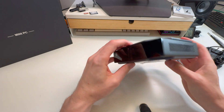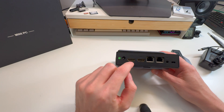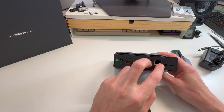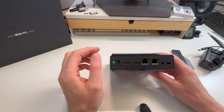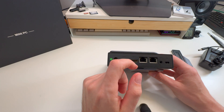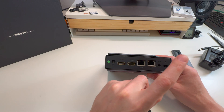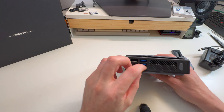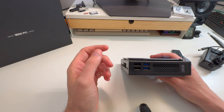There's the LCD on the side. On the back we have a decent IO: DC power in, dual HDMI so you can run two screens, dual Ethernet — which already points towards potential use as something like an ad server or network device. There's auxiliary in for speakers, a lock port, and four USB ports — two slower ports and two faster ports, useful for things like an external NVMe.